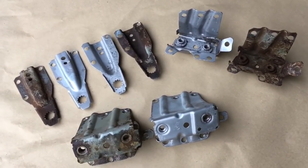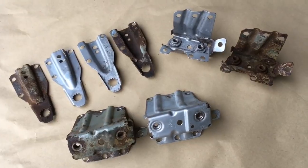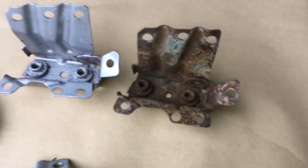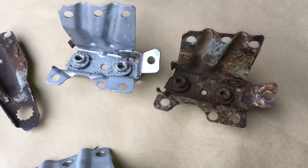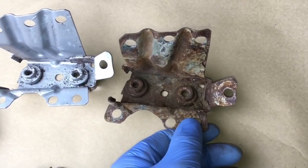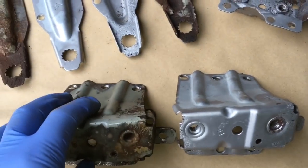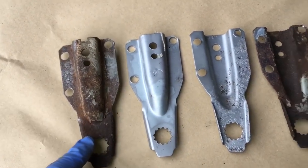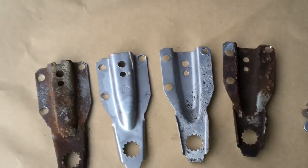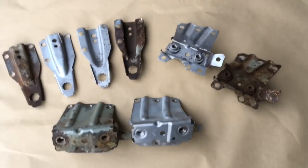Here's the difference between the brackets. This is our exchange bracket programme — we keep a lot in stock that have been blasted. You can't buy these brackets so we blast them and make sure they're as nearly as good as new. There's certainly no tooling that can get all the corrosion and rust off as well as blasting techniques. We still get a few fine bits left, just like on the chassis, but I think most people will agree they'd much rather have that one on their car than a flaky one. So that's the fuel tank strap brackets — there's the blasted one and the non-blasted one.